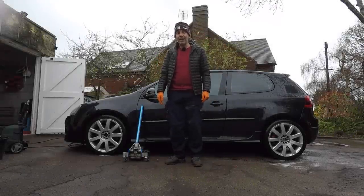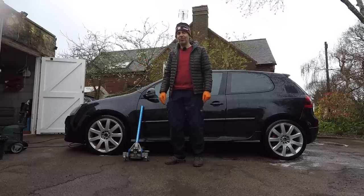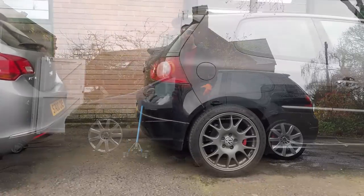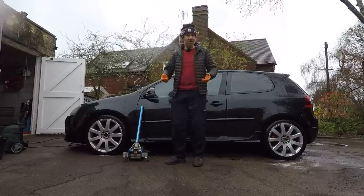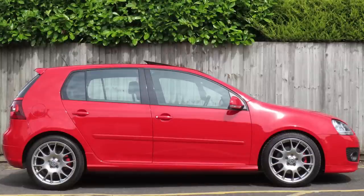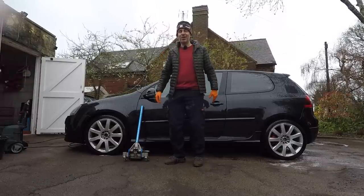Now the paintwork is squeaky clean, but it's just a little bit too wet to bother drying it off, so we'll have a look at the paintwork later on when it stops raining. In the meantime, I thought it would be a good time to refit the original BBS alloy wheels. Just to recap, the wheels were very similar to the ones an Edition 30 should have, but instead of being the Volkswagen version made by BBS, they were just the BBS version called the VZ. The big difference is that the offset is slightly greater, so they're an ET44 rather than an ET51. The good news is it gives the car a bit more stance. The bad news was that they were a little bit too dark. The original Pescaras have got smoky silver, which is quite subtle. These were verging on grey, and on a black car I just think they looked not very good — they weren't very flattering, they just looked dirty. So I've gone for a different colour, which I hope you guys will like.